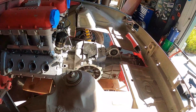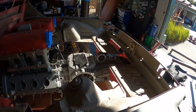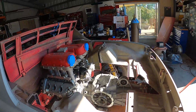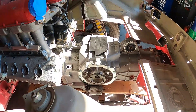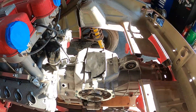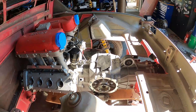On my LS car I ended up notching that rear panel because there's room between the panel and the bumper, so worst case if the whole drivetrain had to go back a little more, that would be okay. And you can see that axle angle to the stub axle input on the trailing arm is fine, so even if we have to go back a bit, we are home free on all this stuff.